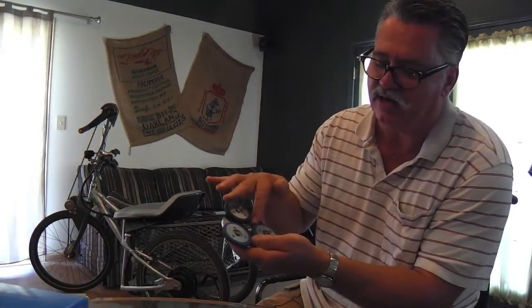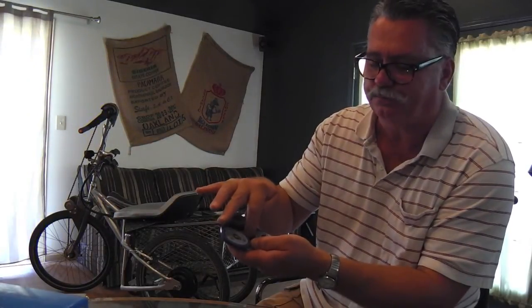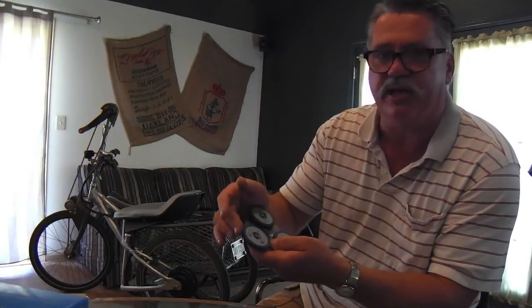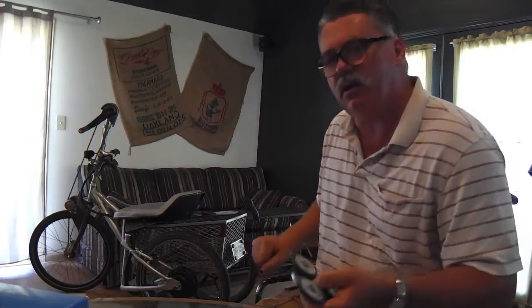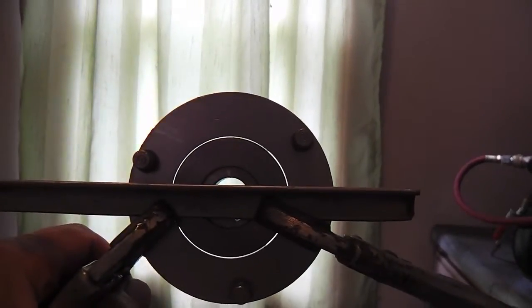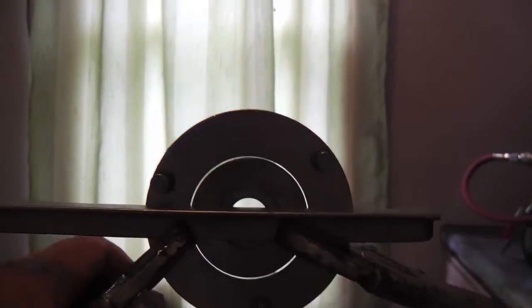That's really one of the big pluses of the BMC motors. They have the quick takeoffs because they have this planetary gear set. When that little gear in the middle gets going, the number of teeth on it is five times less than what these outer gears have, and so it gets quicker takeoffs. The direct drive motors don't have that. If you've got a two-wheel bike with one of them on one of the wheels, you have to pedal a little bit to get it up and running, and then you can back off and lay on the juice. But on these BMCs, you don't have to do this. This thing has quick takeoff. Okay, that's how I'm getting it flush and centered up. I'm kind of liking that.